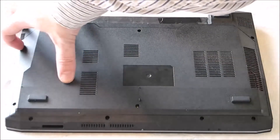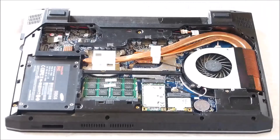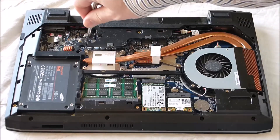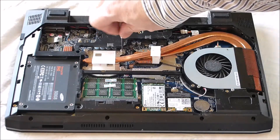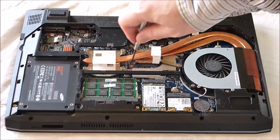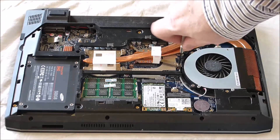As I noted, I already removed these screws. You'll also want paper towel to clean with. The screws on the CPU are captured, so you don't have to worry about them popping out and getting lost — they're part of the plate. The screws above the GPU are removable, so be careful with those. I usually magnetize my screwdriver by setting it in a magnetic tray overnight — it works wonders for holding onto screws so you don't lose them.